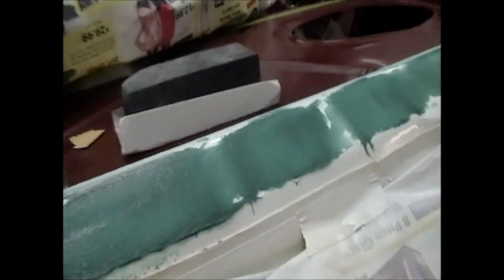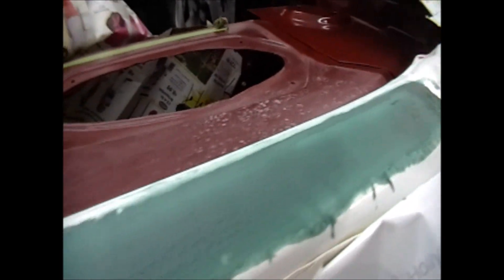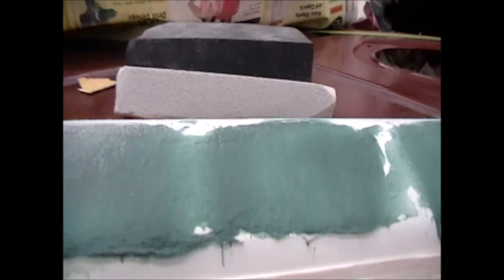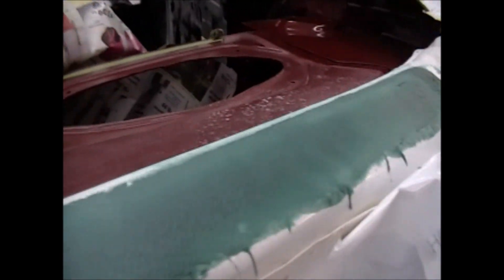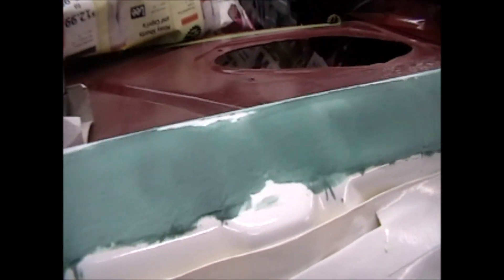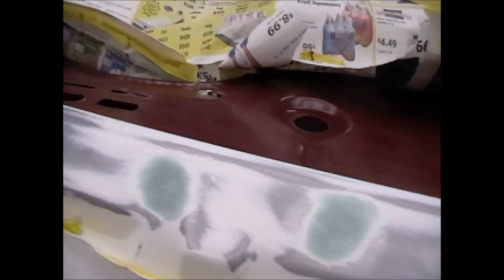I've been working on sanding some of this fiberglass filler that I put down on the deck filler panel. I don't have much experience with any type of filler, but I do know that fiberglass filler is hard to sand and it's hard to spray too. This here is what it looked like when I first spread it over those plug weld holes — this is the right side. I spread it as tight as I could, pressed it in as hard as I could, and about the time I thought I had it looking smooth, a piece of fiberglass would raise up out of it. As far as sanding it goes, it's tough to sand and I'm just using 80 grit.